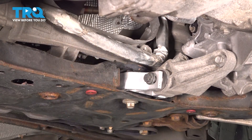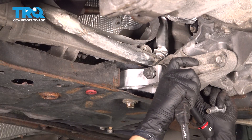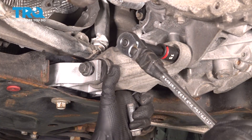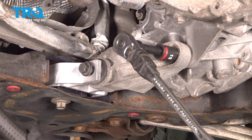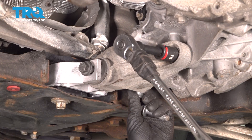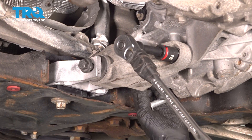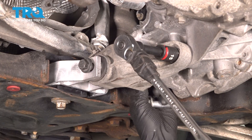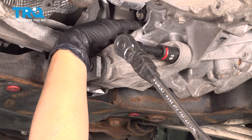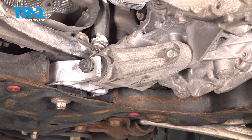Make sure you get this one hand-started before you start putting your bolts in up here. That feels pretty good, and now we're going to get our bolts started on the transmission side. Might have to tap it into place if it looks like it's not lining up very well. This bolt is going to be torqued at 92 foot-pounds, and the rest will be torqued at 59 foot-pounds. We're going to tighten them all down first, snug them up, and then we'll torque them.